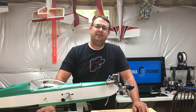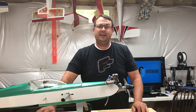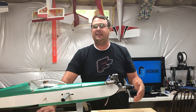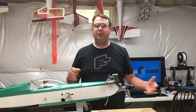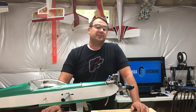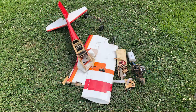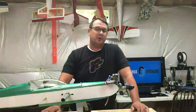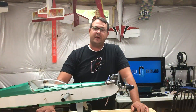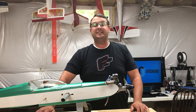What that also did was reveal the age of this particular engine. The seals in the carburetor were old and leaking fuel everywhere once I got the engine running — it was completely just spitting fuel everywhere. So eventually I did replace all of the seals on the engine. And then I crashed it, which I guess damaged the engine, though it was running a little bit rough before that. Then I had to completely disassemble the engine and replace the bearings.